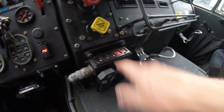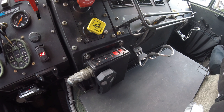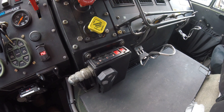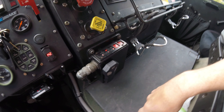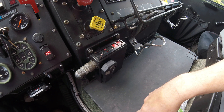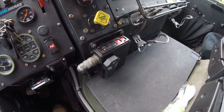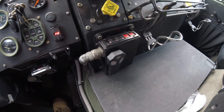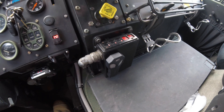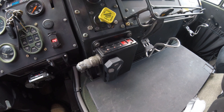The system is now acting normal like nothing happened. Let's try airing down — this is kind of what got it going wonky — then air back up and see if it behaves the same. The truck is pretending everything is fine. Let's try re-inflating to highway pressure. Normally you could hear the quick release valve staying open while it was trying to inflate the tires, but it's not doing that now. Perhaps the wheel valves on the tires have corrected themselves.